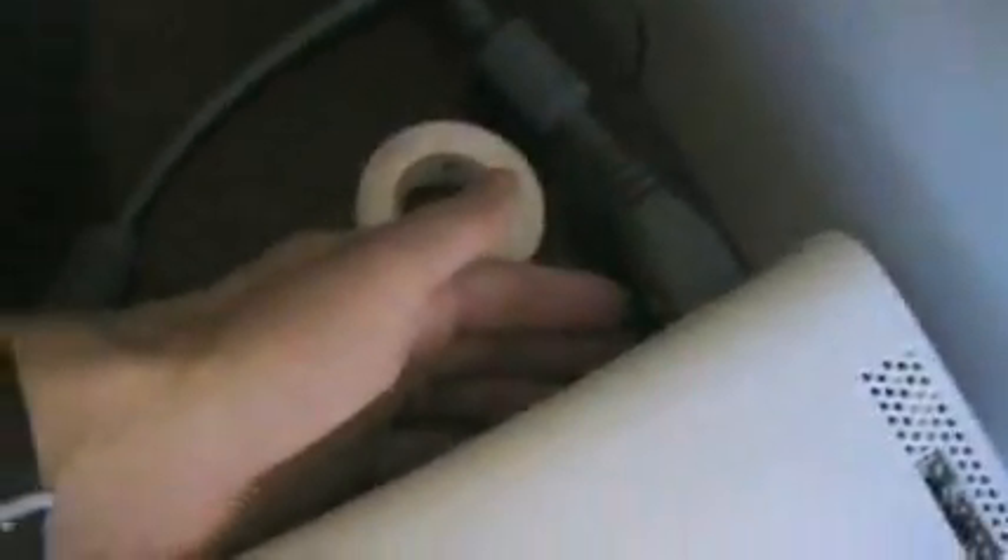I've noticed just the amount of airflow coming out the back — even though I cut the metal mesh, the plastic mesh is still there and it's impeding the airflow a lot. Seriously a lot. It feels like there's half the air compared to when it's straight through. So I might actually just go buy some more grills, which are like a dollar a piece at an electronics store nearby, cut the plastic out. In all likelihood the grill is going to mount up nice using the holes that are already there. That's going to help a lot. I can already feel the air getting a little warmer, whereas with no grill here it was cold — always cold. I ran it after I set it up for maybe half an hour and it was cold the entire time. So I think I might be doing that in the next few days.